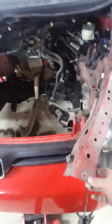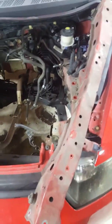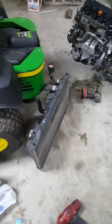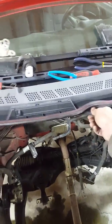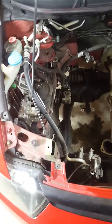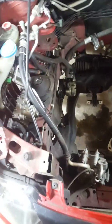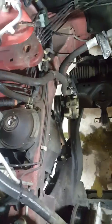All you have to do is remove the radiator support — on this car it's bolted in, not spot-welded, so it's easy. There are about eight bolts total. Take the hood latch loose and set it aside, pull the radiator out, and that gives you four or five more inches of clearance. I also left the AC compressor lines hooked up — just unbolted the compressor and slid it back. The power steering pump is two bolts; just let it dangle.